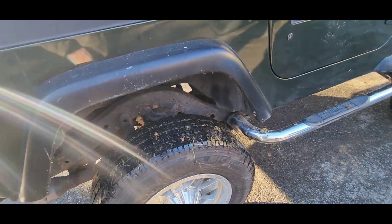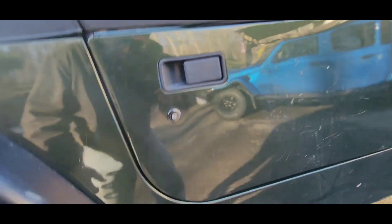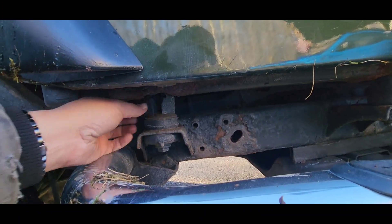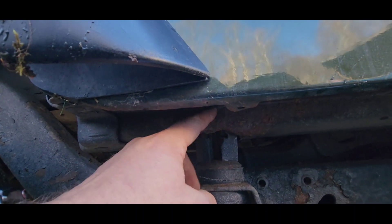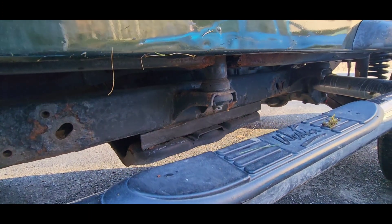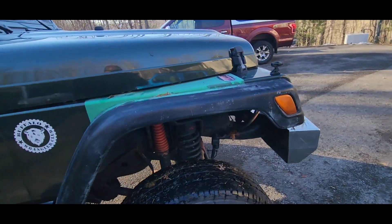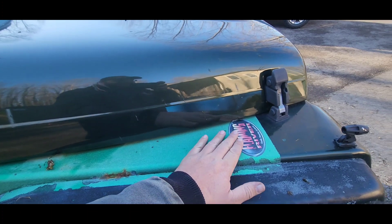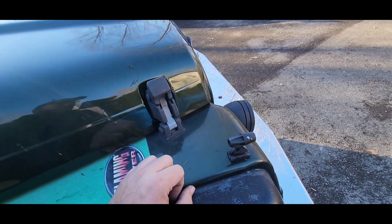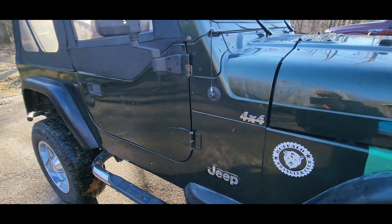Got a Banks exhaust system on her. We've got wires for god knows what — I have to figure that out. Some more of the classic TJ rot windows, not that horrible. Coming back over here, she's got a two-inch body lift on her, but I don't think the mount is supposed to have a crack in the side of it, and it probably should not be inside the body. Got a transmission drop. Appears to have Skyjacker four-inch lift springs. Got sway bar disconnects — another really well-matched green. We put a sticker on it, so that makes it better, and a deer whistle — yeah, we don't need that.